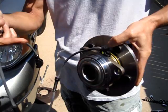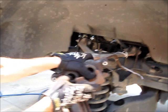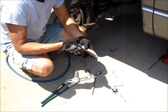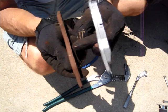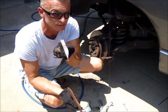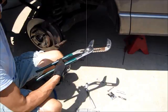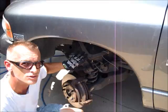We're into the brakes now with the hub replaced. As brake pads wear, the pistons protrude much further outside the cylinder. This vehicle was in such a state of wear — you can do a side-by-side comparison, the old pad is almost paper-thin. Those pistons have come all the way out of their sockets and need to be pushed back in to fit the new, thicker pads. I used a big set of channel locks, placed an old pad across the caliper, and squeezed them back in gently, because it forces fluid back up into the master cylinder.